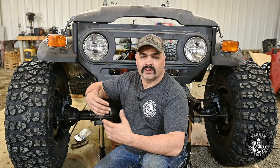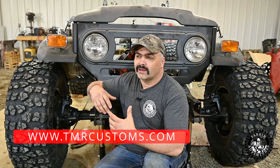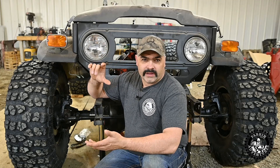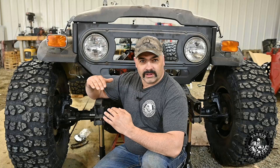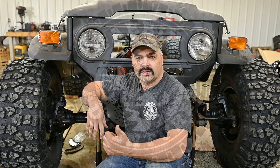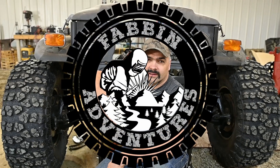We're going to wrap the video up there. I'm waiting on trusses, four links, and three links coming from Ontario from TMR Customs — about a week until it gets here. That'll be the next video: trussing, four-linking, and three-linking. Once that's done we'll get the engine, transmission, and driveline combo more in line and down where we need it — probably set to four and a half to five degrees, which should drop the tail shaft almost three inches and get us a pretty darn good driveline angle. If you're liking the direction the Xtreme FJ40 project is going, make sure you subscribe, share, like, give a thumbs up, and hit the bell to be notified. We'll catch you guys next Friday.